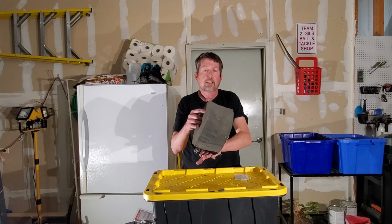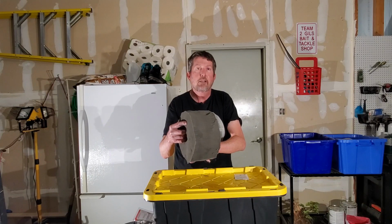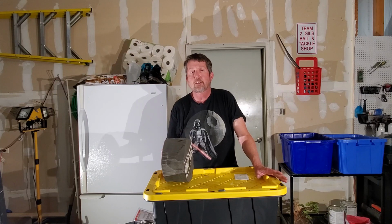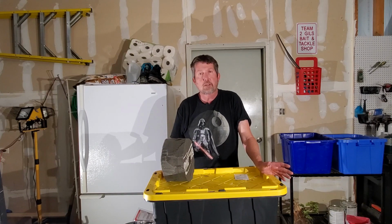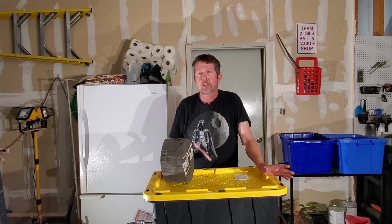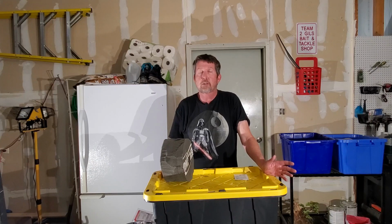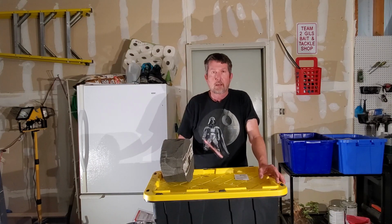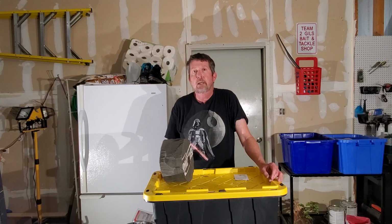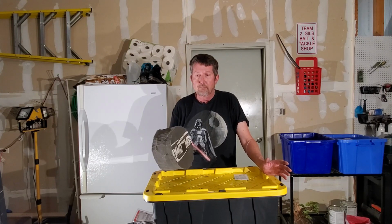So when your tire flexes, if it starts out like this and it flexes, now it's flat, you'll get the maximum traction. That'll get you in and out of the corners. So that's kind of what camber is. What the optimum camber is for you, I don't know, so spend some time doing some adjustments. If you don't know what to adjust, set it at 0, you're probably good. I'm going to start off with mine at about -1. I might go up to -2 and just keep progressing there, see how it goes. I need some really good turning on that.